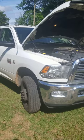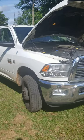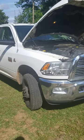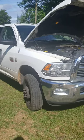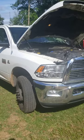So I got to looking at it, and what I did was I drove this thing and got it hot, came back, parked it. I bled the air off safely without getting burnt, and I put my pressure checker back on it and pumped it up to 18 PSI, what it says on the cap. Hopefully this will help some of y'all out.